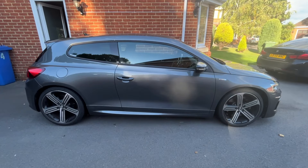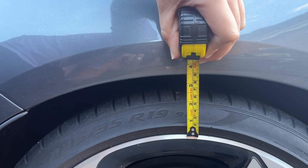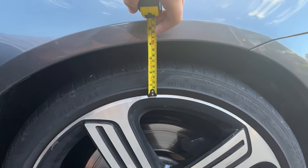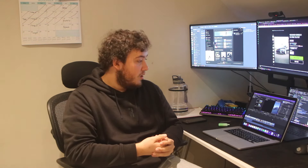Here it is now, lowered. It's the day after — they're not quite as low as I want but it's definitely sitting lower. Last time I measured it was about four and a half inches, now it's about three and a half — so it's gone down by about an inch. The front is about the same, sitting about four inches from the top of the wheel. It's looking a lot lower and a lot cleaner with the 45mm springs on. What I didn't know is that from factory the Scirocco is already lowered by 20mm, so these 45mm springs are only dropping it down 25mm — plus the extra drop after they settle. I think it looks great, and maybe in the future I'll go lower or put coilovers on so I can adjust it.